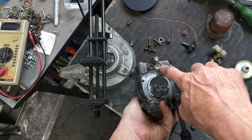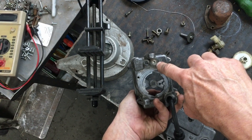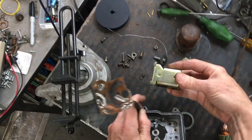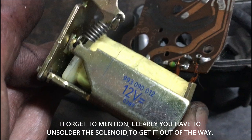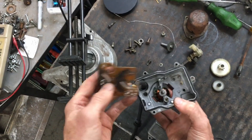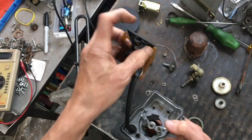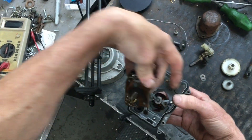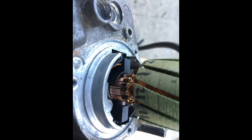There's also a freeze plug here, which is basically a glued-up thing. I don't know what that buys you — there's nothing under it except the back of the solenoid plate. Once you've done that, the armature is sitting in there, and the brush holders are hidden underneath the circuit board, tucked in that slot right at the commutator.